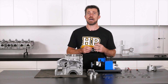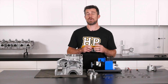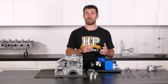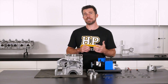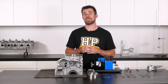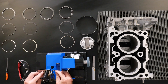In this particular engine, we're running a 3.4 inch bore. If we were to set our ring end gap with a 4 thou per inch end gap, we're going to be aiming for somewhere around 13.5 to 14 thousandths of an inch. So in this instance, I'm going to show you the process of removing a couple of thousandths of an inch of material from that ring. We're now going to take the ring out of the engine block and fit it to our ring file.